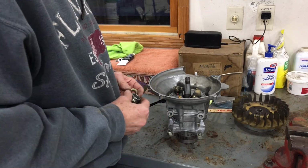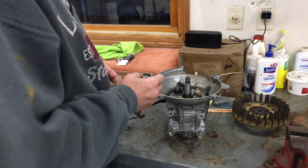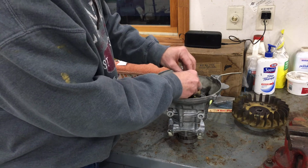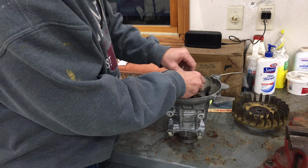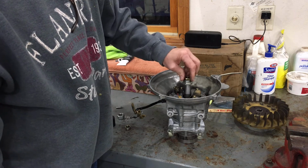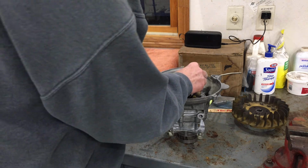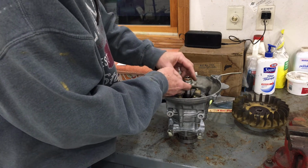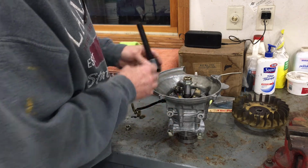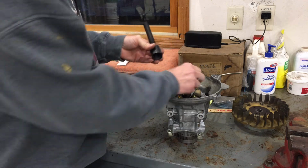So on the fan side, you're going to use the same adapter from the tool, and the suggestion was just put that on there and then take your flywheel nut and thread it on. My concern was that I wasn't engaging 100% of the threads on this nut because of the diameter of this collar, or there's even another one I could try. Wasn't threading on far enough, but anyway. The other issue is, even if that was threaded on further and deeper, it doesn't fit up inside the puller plunger, whatever the correct term is.